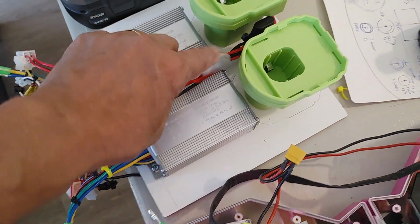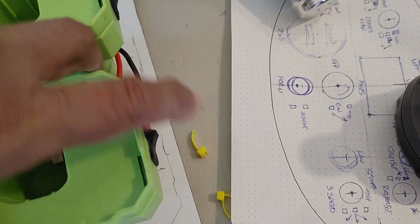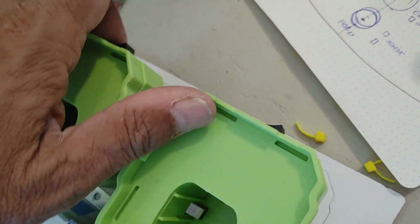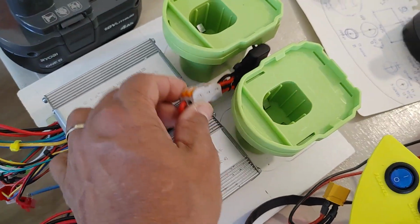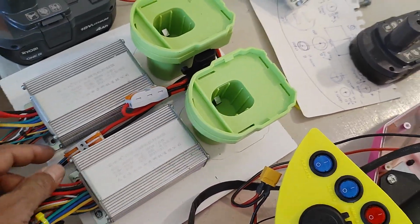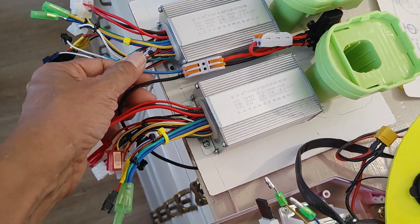These came with these power wheel adapters. Like I said, these are individually switched, so it's for extra safety. Once the car is connected, you can switch this on, but if both of them aren't on, it's not going to work. They have individual fuses. This is connected in series, and that makes up 36 to 48 volts, and that's what's coming out of this connector here.